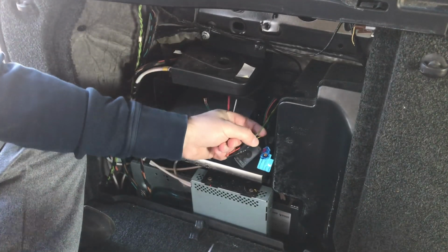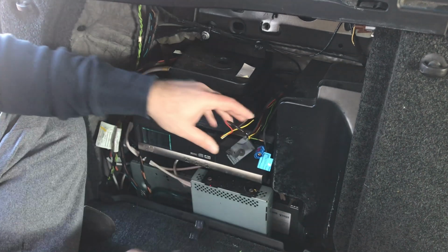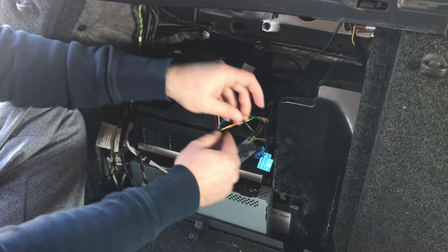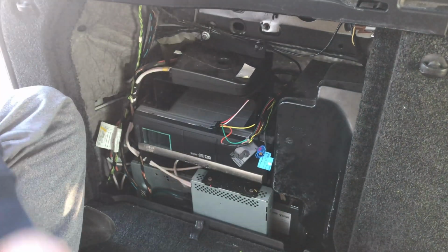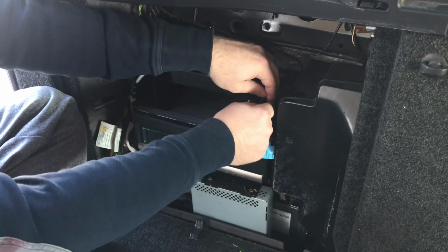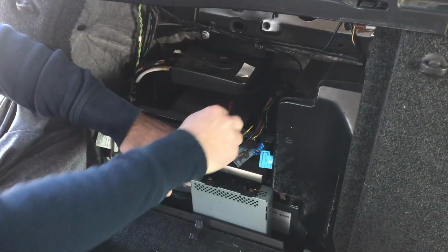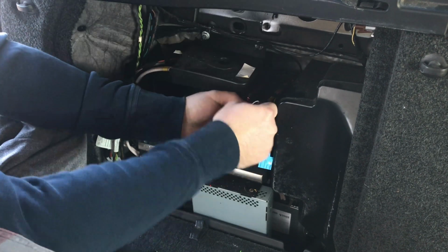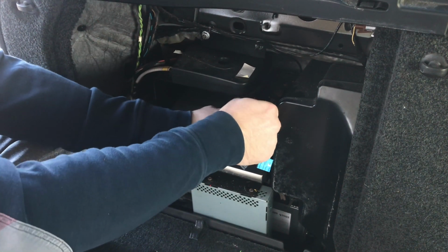Now cut the green wire from the supplied harness. You want to connect the green wire together to the connector side. Alright, and now you got the other end of the green wire, and you're connecting the white wire to the other side of the green wire. So your CAN wiring is now completed. So it's only two wires, CAN high and CAN low.